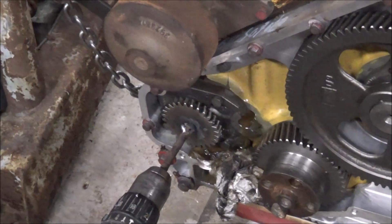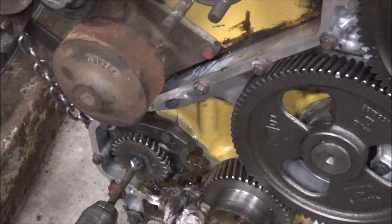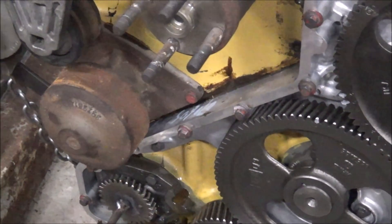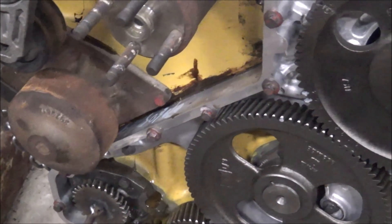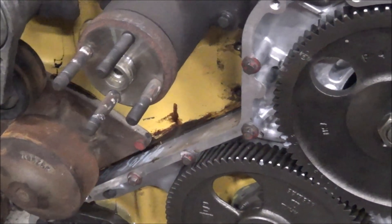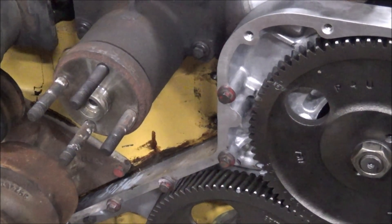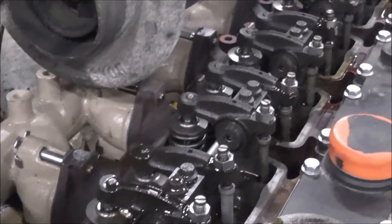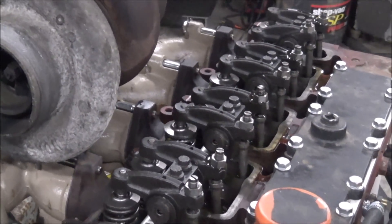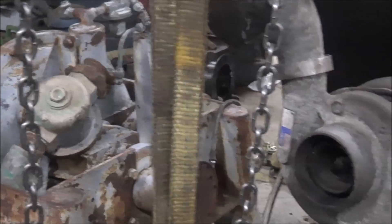Sometimes I'm a little messy, but what I did was take the shaft from a broken oil pump that was scrap out of this thing, so I could hook my drill onto it to pre-lube. That way I can run it, draw oil through the sump, and push it through everything as it's supposed to be lubricated. I've had a little success already — you can see the oil starting out those rockers. Some of them are still dry, so I'll hit it a little bit more and try to get it to lube all the way down through there before I button the top up.